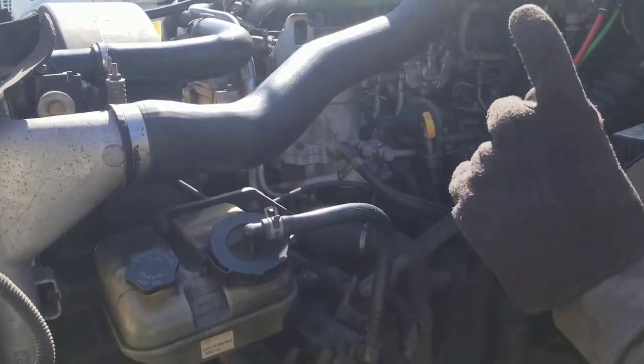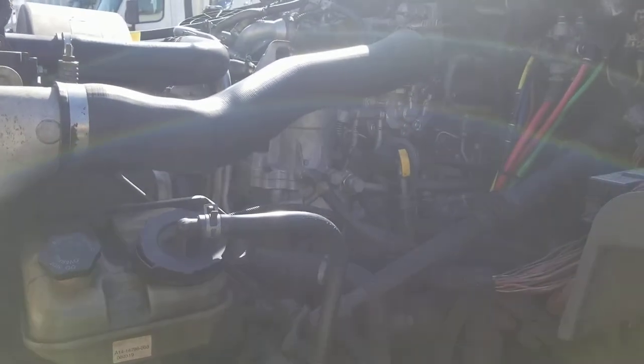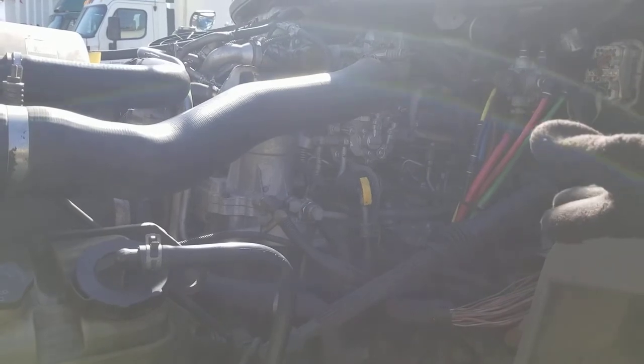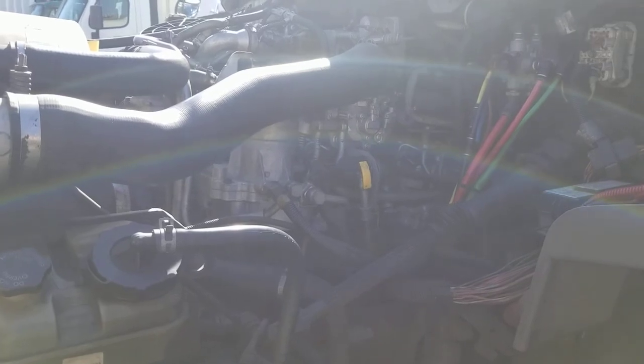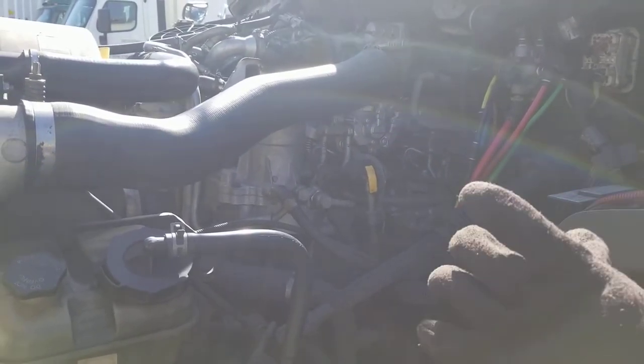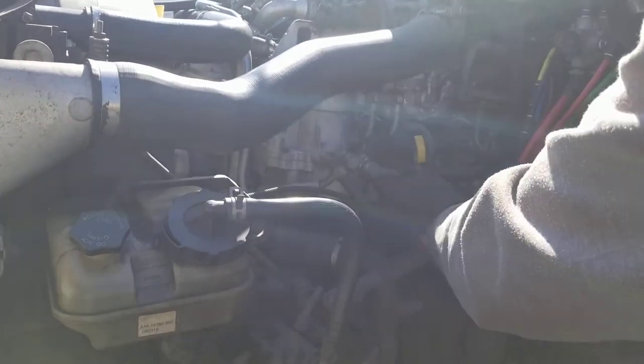This is the most important item right here — that's your air compressor. Your air compressor is mounted to the engine and connected to an air governor. The job of the air compressor is to produce air for the air braking system. It is gear driven. There cannot be any air leaks coming from the air compressor or any of its components.